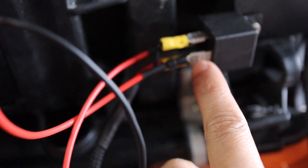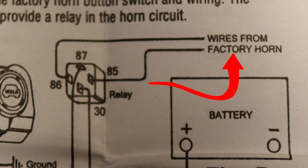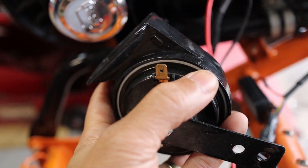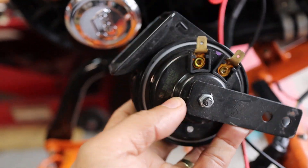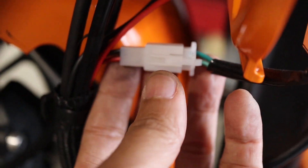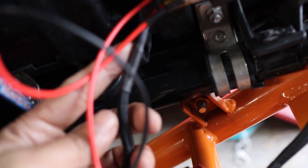If you look on the diagram, the left and right side connect to the relay — those are the two wires that come off of your horn. This is similar to the horn you'll have in the front, but it'll have two wires, and this will be sitting in the front of your battery box. It has two connections like this. What I did was I took those connections — right here it says horn — the stock bike also has these two, and I created a clip and then extended it all the way up this cable and into here.